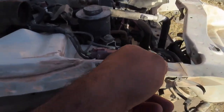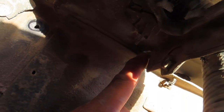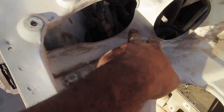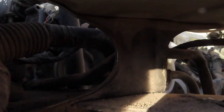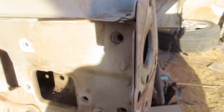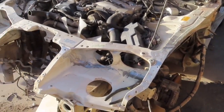We're going to cut from right here and work our way down into that pocket. You can see the pocket — we're going to cut down to this little gap right here, because this other panel where this bolt is welded is part of the headlight. This panel, this panel, this panel, and this panel all get smashed together. I'm going to cut to this little gap so it separates from the wheel well, then I just have to air hammer that little piece off. That'll separate it completely and remove the one spot weld right here. After that, this whole thing comes off — same thing on the other side.